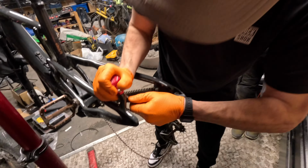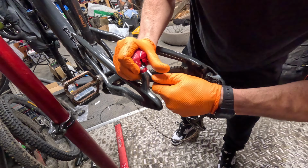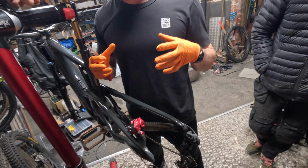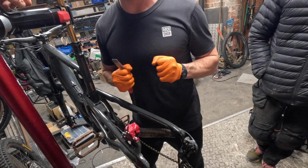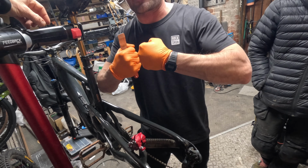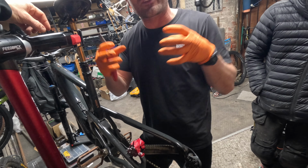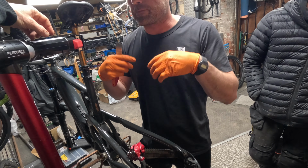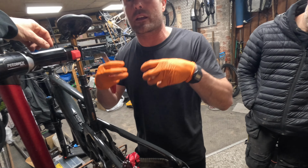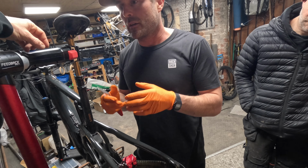So essentially you're pushing the pads out and then pressing them back in. So why are you doing this? So think of it as a massage for the pistons. That's the way I put it. So just cycling those pistons in till the pads come in contact and then pushing them back, so they come in contact, put them back again. It's just getting the quad rings, which is what wraps around the pistons, properly lubricated. Kind of moved up and moving, and that's going to translate to better lever feel.